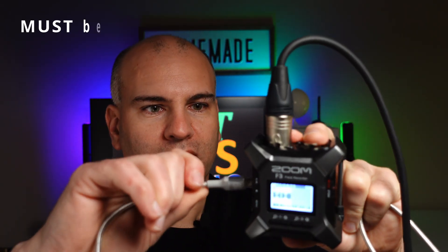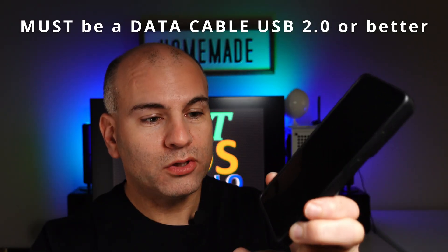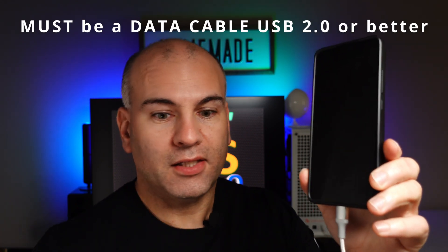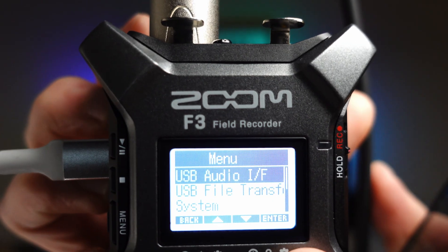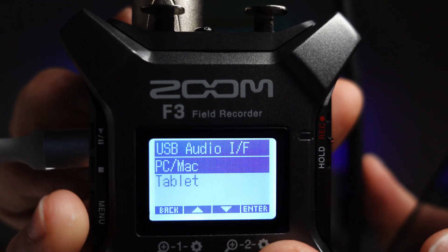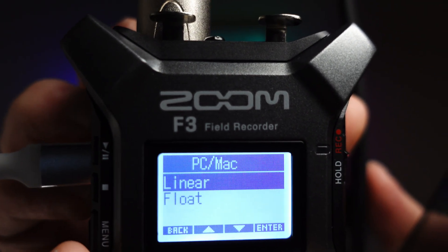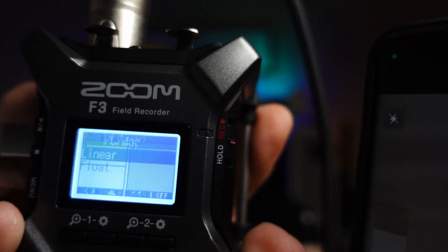For connecting an iPhone or any other method, you're going to need a proper Lightning to USB-C adapter — find something hopefully certified by Apple, or else it might not work. For Android it is very, very simple: I simply connect a USB cable to the phone, no special trick. It can now be set up as an audio interface. For PC with Android I choose audio interface, and choose PC/Mac for Apple devices. Note that you can't choose 32-bit float for the phone — you have to choose linear.